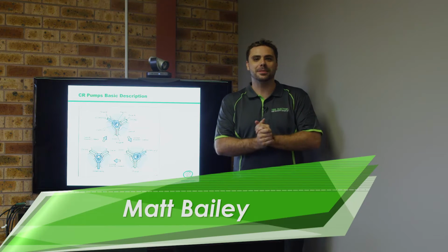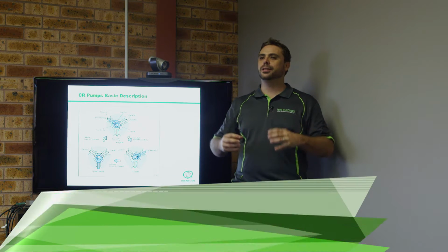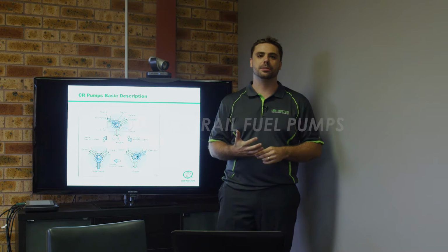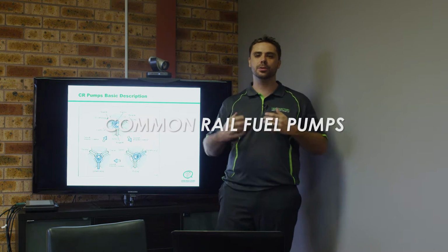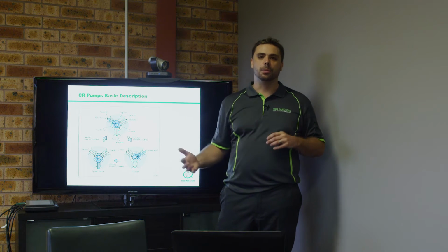Common rail fuel pumps, interesting topic and one that's talked about a little bit, but generally speaking, we find that the common rail pumps themselves are ridiculously robust. So I just wanted to show you guys a little bit around how the pump actually works, and when we talk about a suction control valve, why they're so critical to the overall engine performance and engine running.